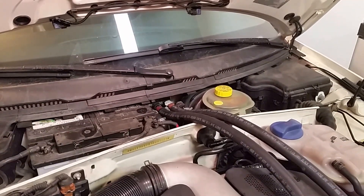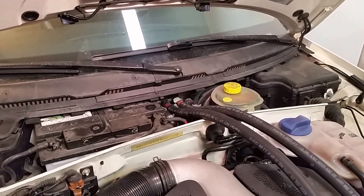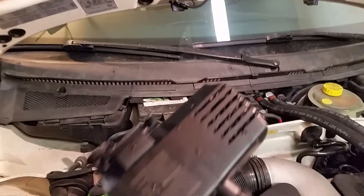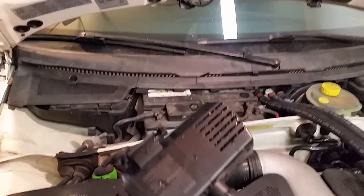However, cycling the solution through is the difficulty. What I have here are some three-quarter inch hoses that I connected to my heater core, and I've been reverse flushing it with something as simple as a $20 aquarium pump.